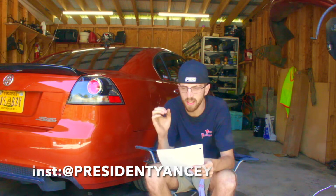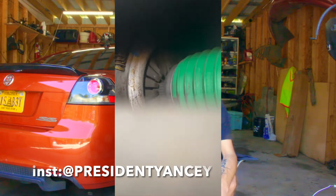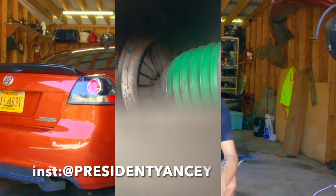The pilot bearing is just ordered from the 5th gen Camaro and put onto the flywheel you get with your clutch. Super easy. These are actually easier to do than the F bodies, because the pilot bearings mount to the flywheel instead of in the crank, so it's a whole lot easier. Make sure you put your anti-seize on that pilot bearing first, and make sure everything lines up first. And do not pull the transmission in with the bolts.